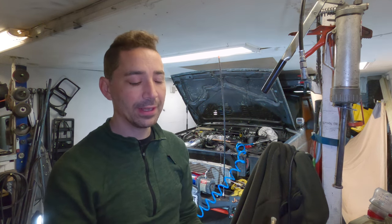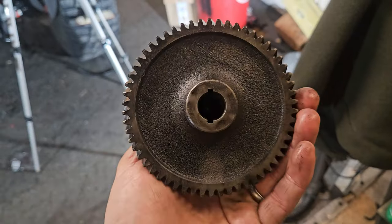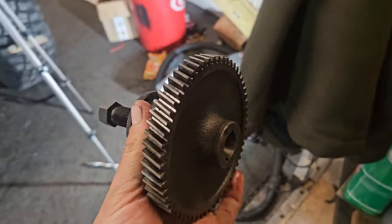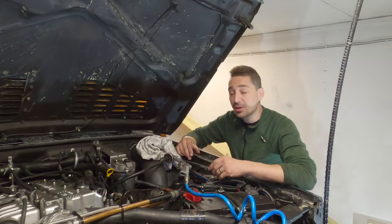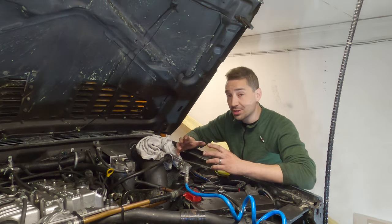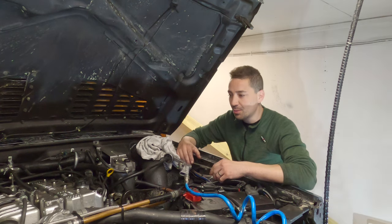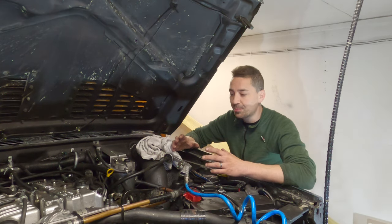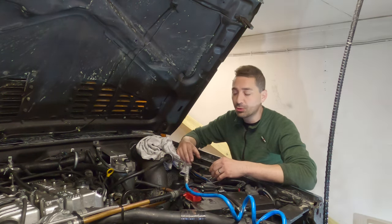And that's my problem really — I just can't stop playing with it. But considering I bought the pump I just wanted to see what it would do. Really if I could get a little bit more low and mid-range power and maybe get that turbo coming in a bit earlier, I think the behaviour of the vehicle would be fantastic. I'm not so interested in what it does up top; I'm just looking for something stable, and I have to keep my eye on the EGTs because obviously that 11mm rotor head and that pump is going to be delivering more fuel.